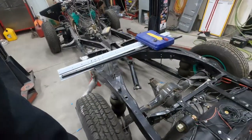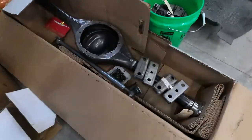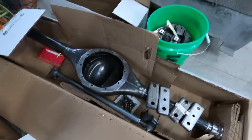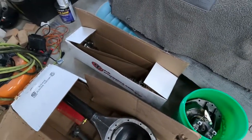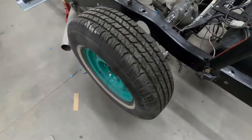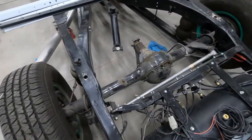What's up guys, welcome back to the channel. Tonight I'm working on this rear end. I've got all my new parts for the 9-inch that I just got from Quick Performance — a new housing, a track bar kit, center section with 3.50 gears since I don't have overdrive, and new 31-spline axle shafts. Time to get this old stock six-lug rear end out and get the new axle ready to rock and roll.